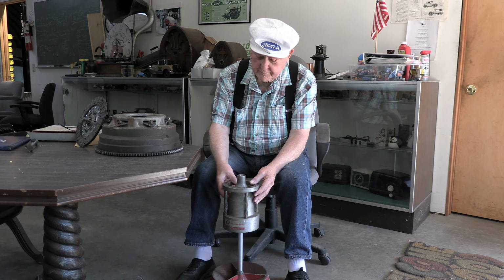So we're going to take this arm, we're going to put magnets on it to make it convenient. We're going to put this bolt on so that the head of this bolt is 1/2 inch below the surface of this magnet. Now it's hands-free. You can just lay this in there. And what I like to do is set that at 1/2 inch and then take say a 20 thousandths feeler gauge, which is convenient, and lay it in between the head and that, and then you adjust this nut.